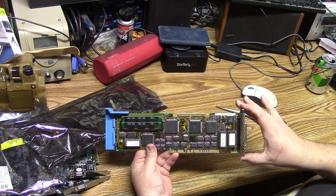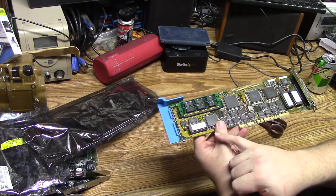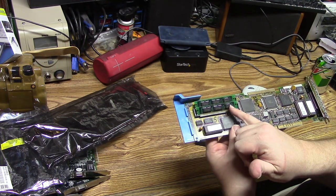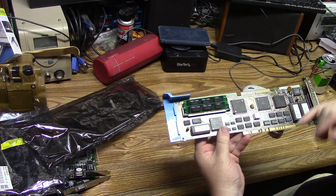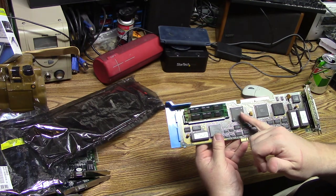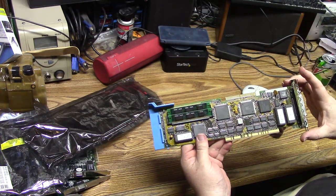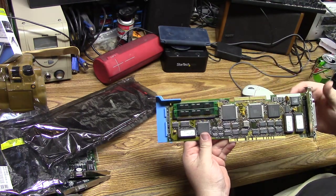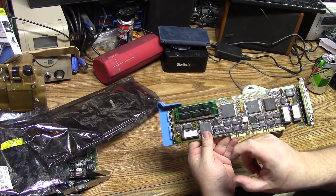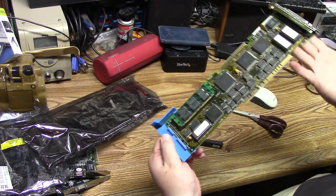Number two is obviously sound cards, but you can get around that. These are almost certainly 256K SIMMs — two chips, might be real or a fake parity. If you ever find one-megabyte versions that work in this card, they're also for the IBM Model 25 and 30 286. There's a little bit of overlap there, but those one-meg SIMMs are very uncommon unless you make your own. You can take a normal SIMM, modify it slightly with bodge wires, and make it work — not exactly optimal, but it is what it is. And that is the end of the box.